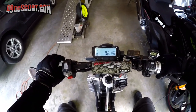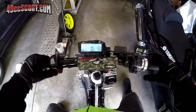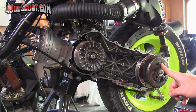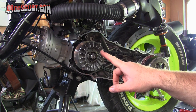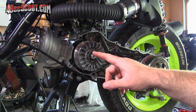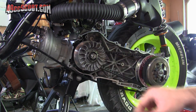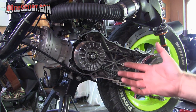I think that might be my problem right there — if I could get it to jump up to 8,000 instead of 7,000 off the line, I might be in business. Generally the clutch seems like a pretty obvious choice when you want to get RPM up off the line, but being a stock clutch with just light modifications, my overrange variator seems to do a lot of work at getting RPM up for this transmission setup. So I'm actually going to try lighter weights — I've got three 8.5 gram weights, I'm going to mix those with three of the 10 gram weights that are in there, and that'll average out to 9.25 grams.